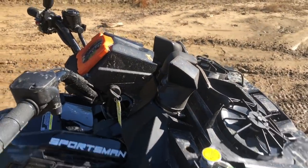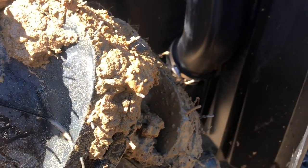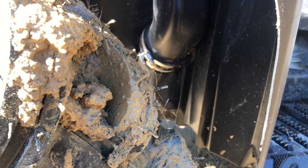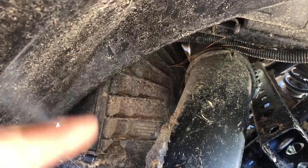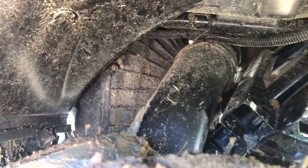One thing I do not like, and I guess what I've heard from other people, is here you can actually see the snorkel going back under here. So you see your snorkel coming in, and they only have these pipe clips on them, these clamps that clip over. Obviously, maybe I'll look in the future towards getting an actual sealer on there, because you hear a lot of people say that. And there where the belt is, I don't know how good you can see that, but under that big case right there is where the belt is, and the seal around that, I guess, leaks for some people also. So a lot of people say that it's important to try to reseal that as well.